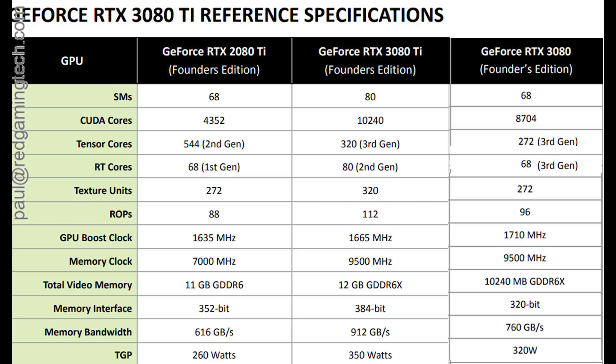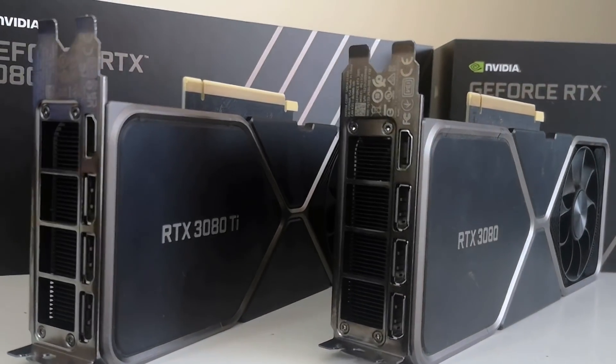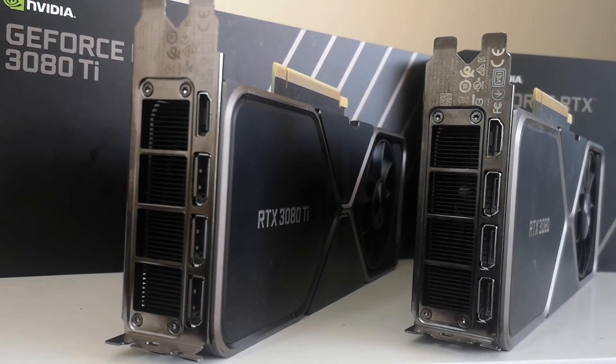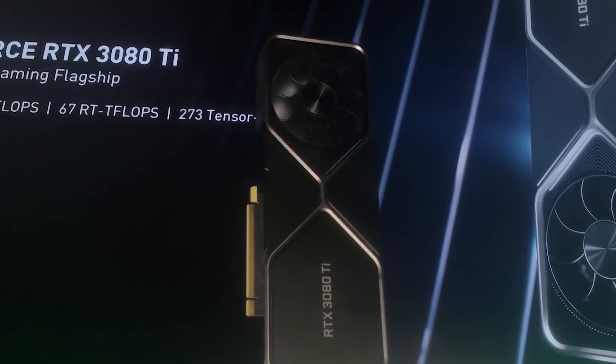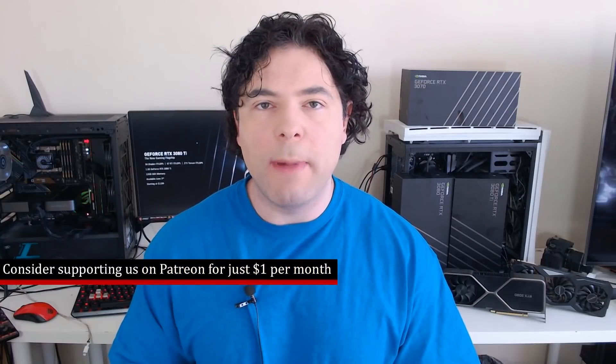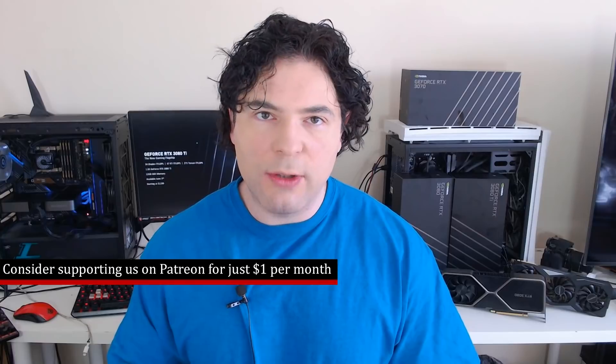Because there are 80 SMs enabled in this configuration, we also have 80 ray tracing units, and the RTX 3080 Ti also sports 320 tensor cores, important for DLSS. Overall, it's a noticeable spec bump over the RTX 3080 vanilla, but not quite enough to completely render the RTX 3090 without purpose. The real difference between the 3080 Ti and the 3090 lies in the VRAM configuration, with the 3080 Ti only having half the amount. This card would not really be something you'd run for 1080p, and it's frequently CPU bound even with our Ryzen 9 5950X running 4000MHz RAM.